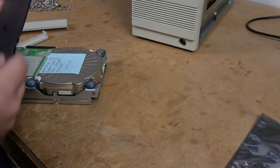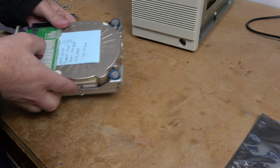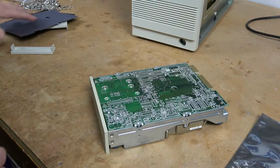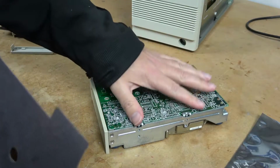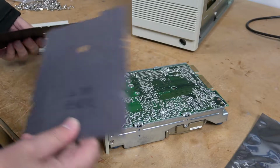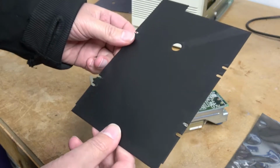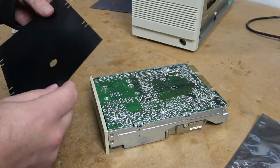The next item will be our RLL hard drive. And since I've been working on this particular drive, I did have to remove the control board. Most of these drives have a paper cover on the back that protects the control board from hitting anything metal. I used this one as a template and was able to 3D print my own. This is 3 layers of PLA plastic, and if you're interested in this particular STL, just leave a comment down below.